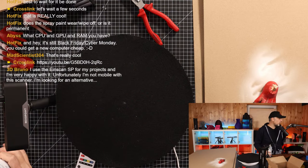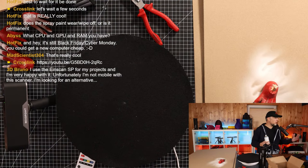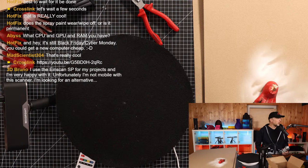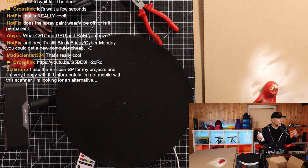My computer is an AMD 5600X, so a 6-core processor. So I think it's 12 virtual cores, 6 physical cores. I would say it is good enough, fairly fast, but could be better. I mean, the better compromise now is probably the 5700X, which is actually pretty cheap at the moment. I think 136 euros. Saw it recently. And then you have an 8-core processor. It goes up to 4.5 gigahertz. So pretty capable, I would say. So I'd say this computer is already good. But if you're running an encoding of a stream at the same time, it's still going to cause some issues.